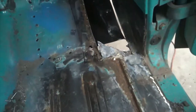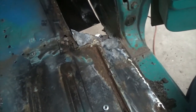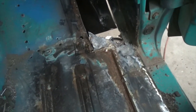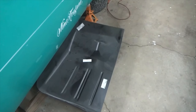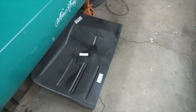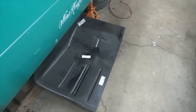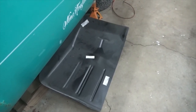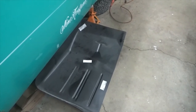So now I'm going to prep the inside for the floor pan piece. And here's the floor pan - I'm just going to cut a piece out of that. I think I'm going to do a lap weld. So I'll get the truck cleared up and I'll show you what it looks like after I get it prepped, and then just before I weld in the panel.